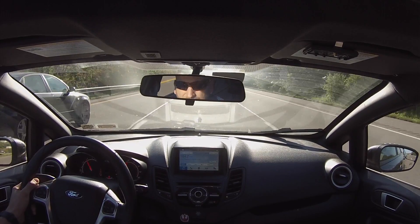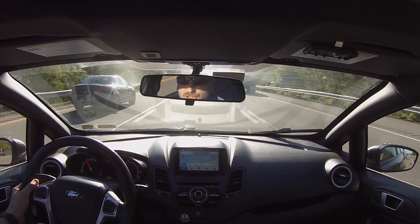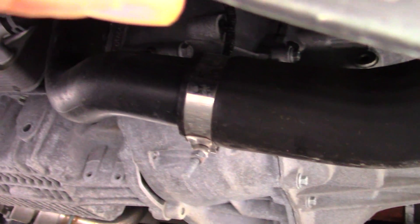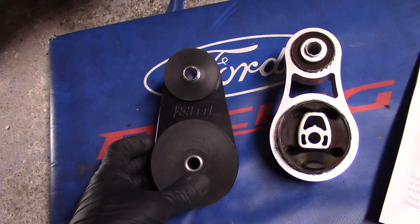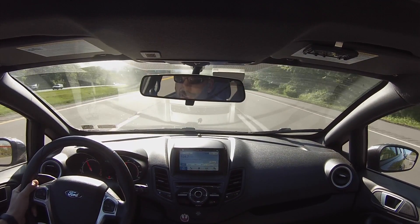Besides that, I've had a few other small issues. One well-known issue is the intercooler couplers. The intercooler is front-mount on this car, and with that weak motor mount it used to have, when the motor would pull, it would pull itself away from the intake coupler and cause a boost leak.